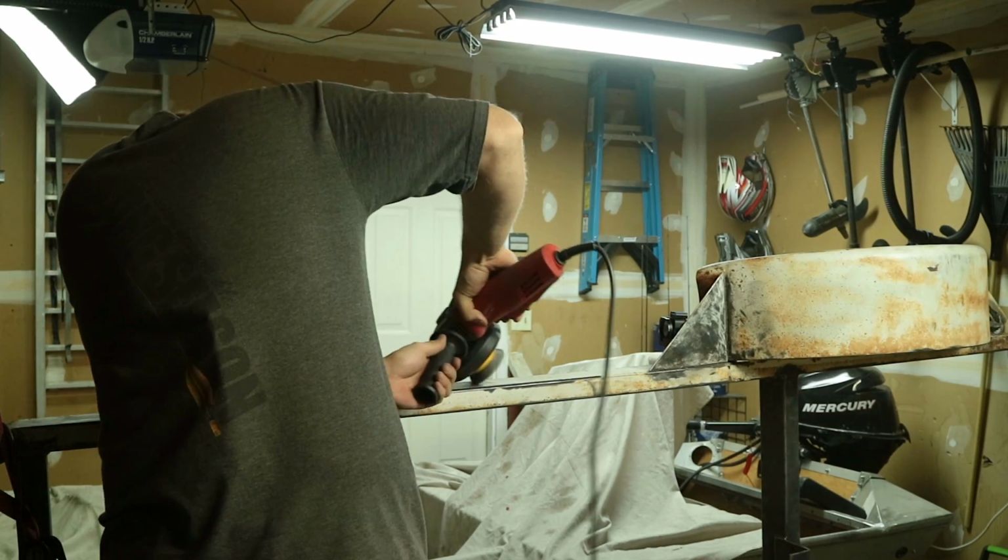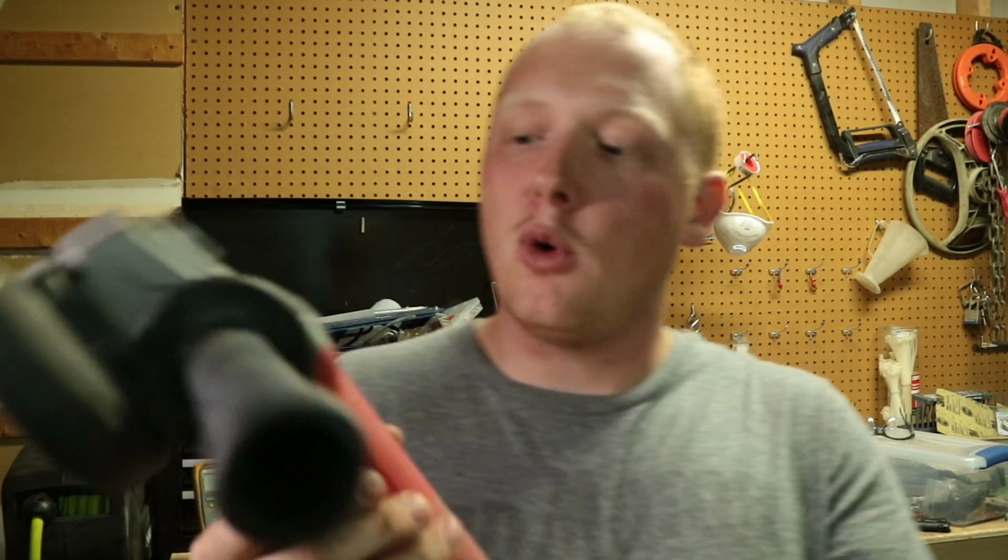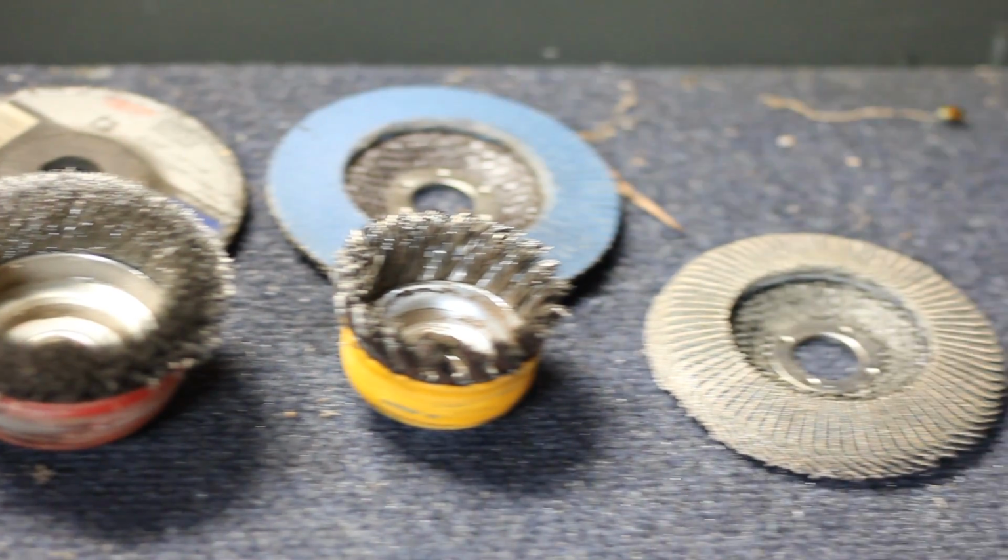Once you have everything removed from the actual trailer frame itself, you want to go ahead and start removing all that rust and paint and everything that's built up over the last 35 years. What I used was a 4.5-inch Milwaukee grinder with a bunch of different variations of wire wheels. Some of the wheels I used were coarse and some of them are a little finer. They make all kinds of ones, and I'll have some of those linked down below in the description if you guys want to check those out.